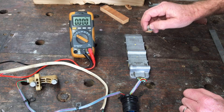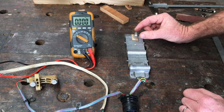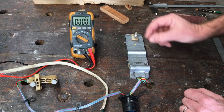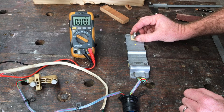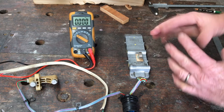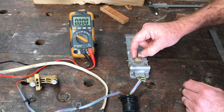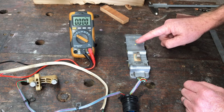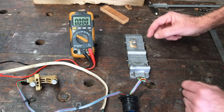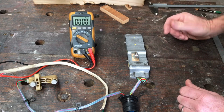With the position of the sensors there are coils in here that measure it, but the central position is not the center — for sensors one, two, and four it's offset a millimeter and a half towards the bell housing, and for sensor three it's offset a little bit towards the back of the transmission because everything's flipped around inside sensor three. Also for sensor three, the relative movement of the magnet gives an opposite response — for example if moving it increases the duty cycle for one, two, and four, for three moving it that way would have the opposite effect.